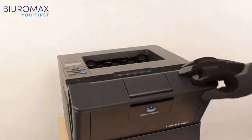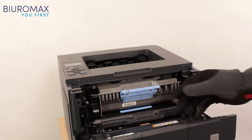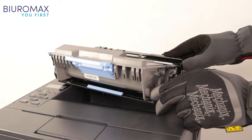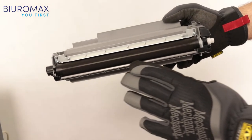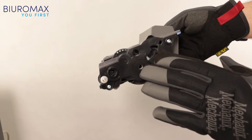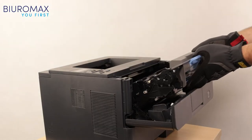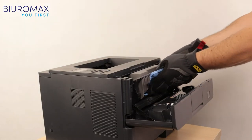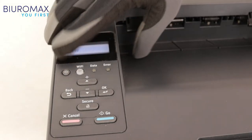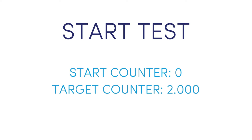When the cartridge is removed from the printer, the original toner is replaced with a test powder. The magnetic roller during regeneration was dismantled and cleaned. The inside of the cartridge has been thoroughly vacuumed of the remains of the previous toner. The regenerated toner is then installed in the printer and the test begins.